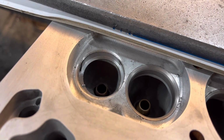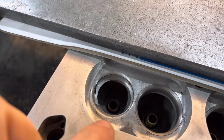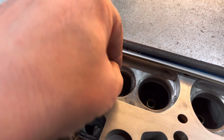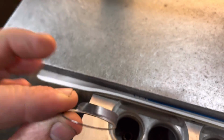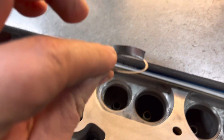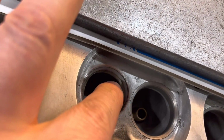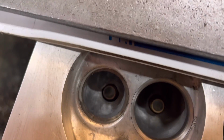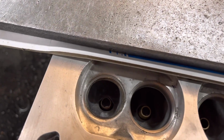So I've just machined down this exhaust seat, and as you can see, we've hit the bottom, and you can see it's started to peel out there. There you go. It all just comes out. The rest of it's just peeled out, and you can see in there where it's just started to actually kiss the aluminium on the outside. So, and there you see it hasn't. So that's out, perfect. I'm going to get this one out the same, and obviously all the rest.